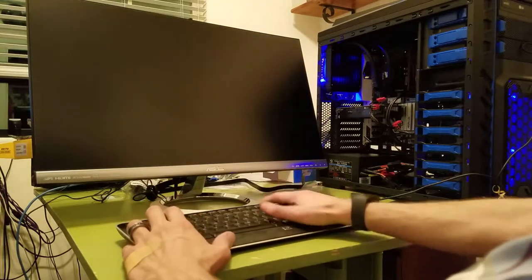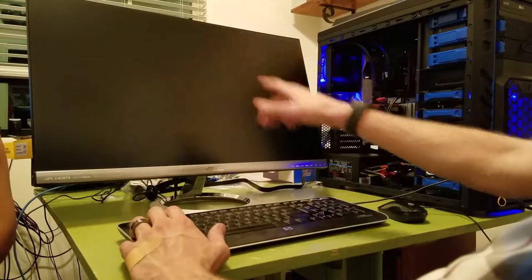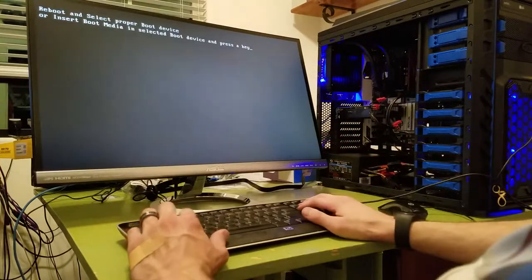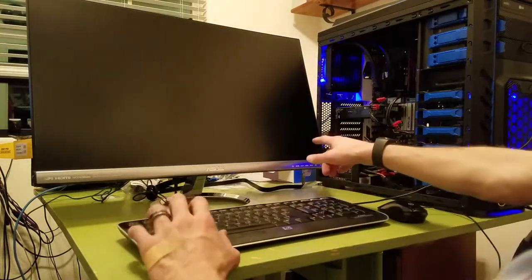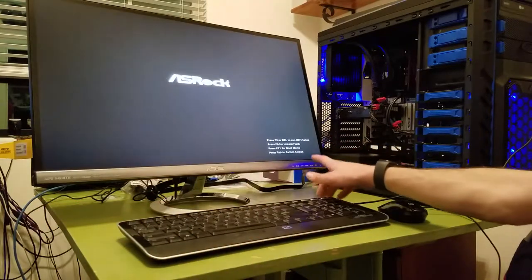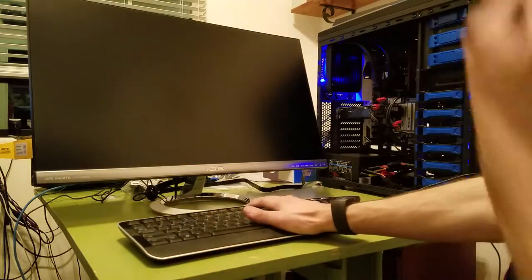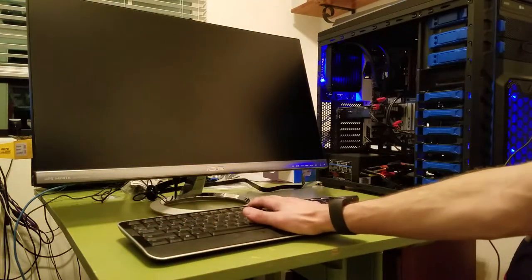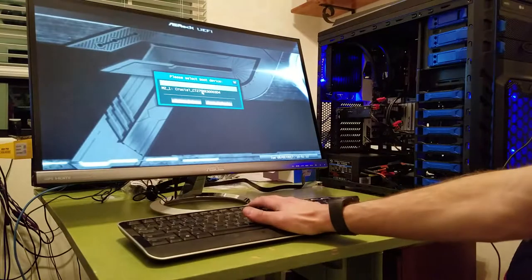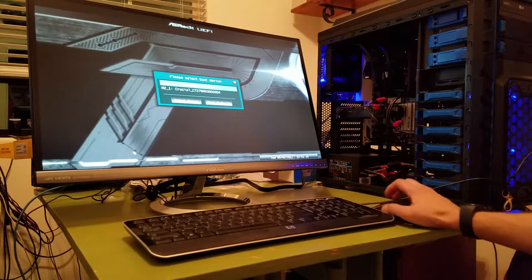Nope. It's not on the network. It is. Never mind. Via Ethernet? It's just so fast, I can't see what the boot options are down here. Usually network is F12. It wasn't. F11. Darn you, ASRock, for changing my boot parameters. The computer's so fast, you don't have enough time. Alright, there we go. So, yes, it's not detecting network boot because it's not being allowed to.